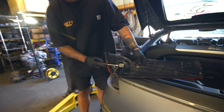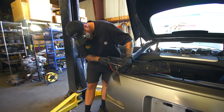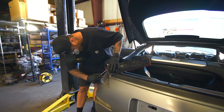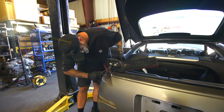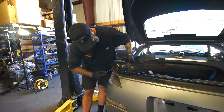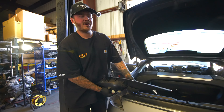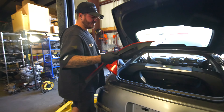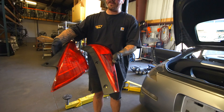Say that your two tabs are broken, or you buy a set that are broken — it's not the end of the world. Those 10s will still keep it in. You won't notice any gapping issues or anything like that. It's just nice to see a tab on there. So there you go — that is how you remove your taillights on a 350Z.